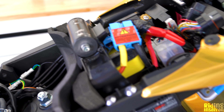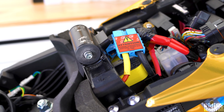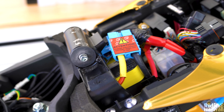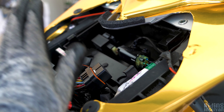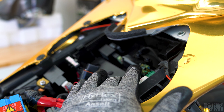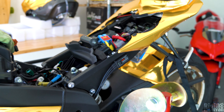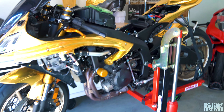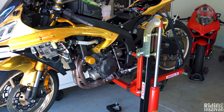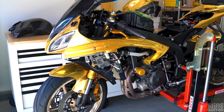We have the lithium battery that's unplugged — I unplugged it about a year ago and it has a perfectly good charge. As long as you unplug it, the shelf life is like 10 years or something crazy. Back here you see these two plugs — they connect into the ECU, the electronic control unit. That has been taken off the bike and sent out to get flashed because we're going to be doing performance mods, and for that you need the ECU flashed.